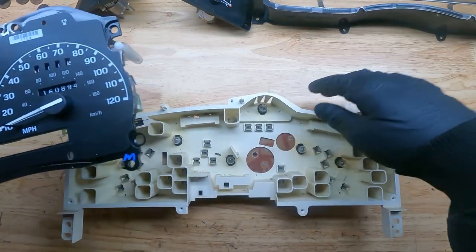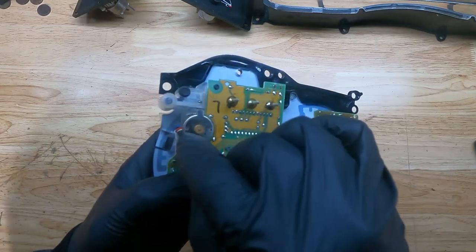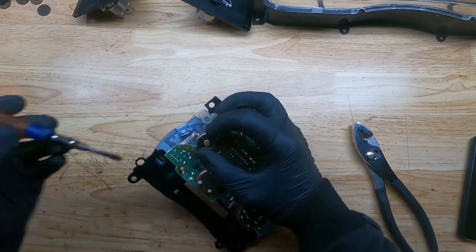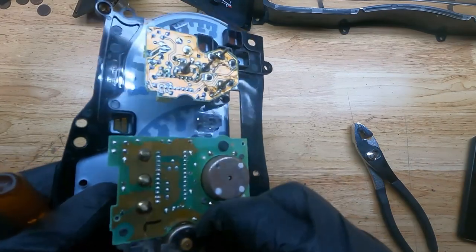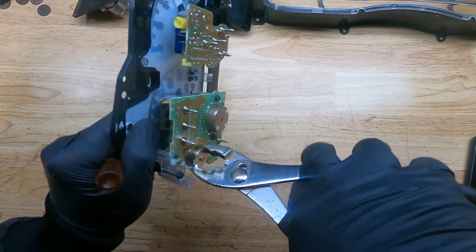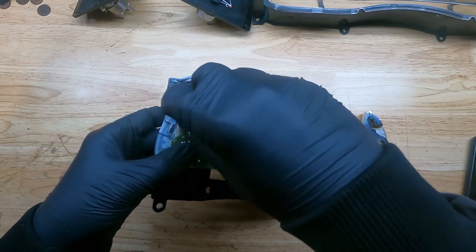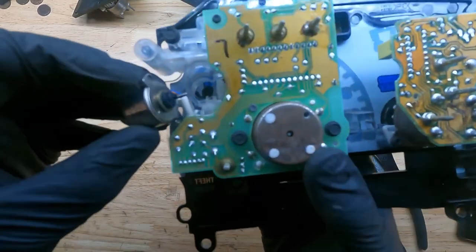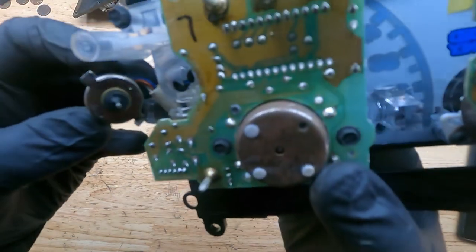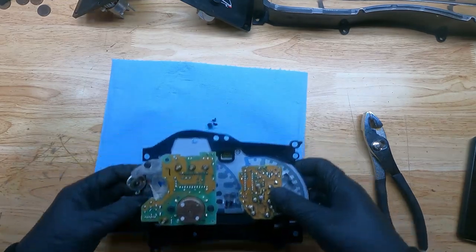Let's get this whole bottom tray out of here. Apparently the part that breaks is a gear right behind this motor. There's a locking tab on each side — maybe I can pry up on the locking tabs to make this easier. Now we can pull the motor out. And oh, look at that. There should be a gear there, but instead all the chunks are inside. That was the problem. That's why the odometer didn't work.